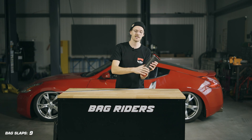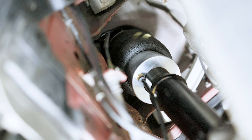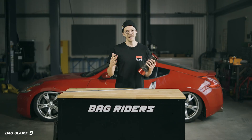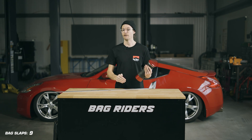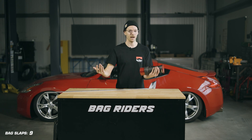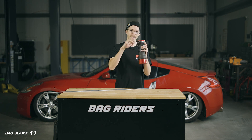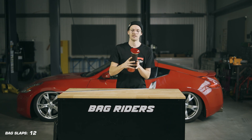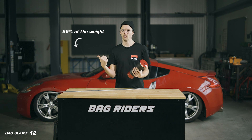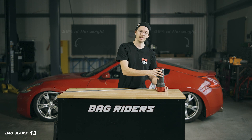You might be thinking: my vehicle has a rolling sleeve bag on the rear struts but the front has a double bellow — should I be worried if I have pressure-based management? If you've been using that system you may have noticed it's actually pretty accurate on the heights you reach. A pressure-based system will only ever reach a preset pressure, not a preset height — that's why height-based systems exist. But do not fear: the inaccuracies and difficulty of unfurling the rolling sleeve bag are much more pronounced on the front of a front-engine vehicle than on the rear, which is why you probably haven't been having any issues.